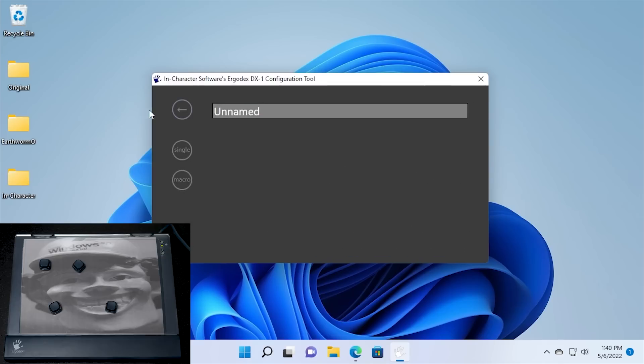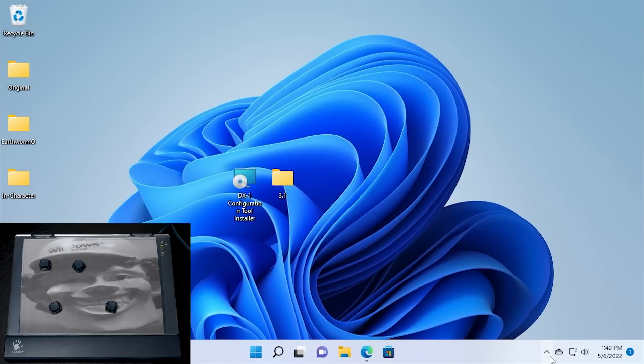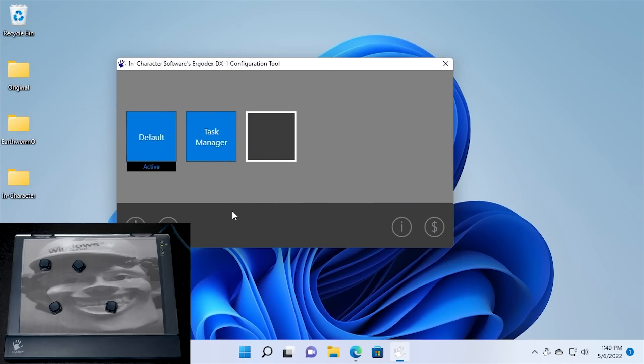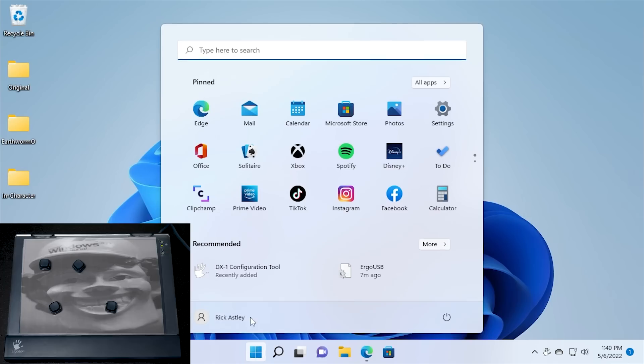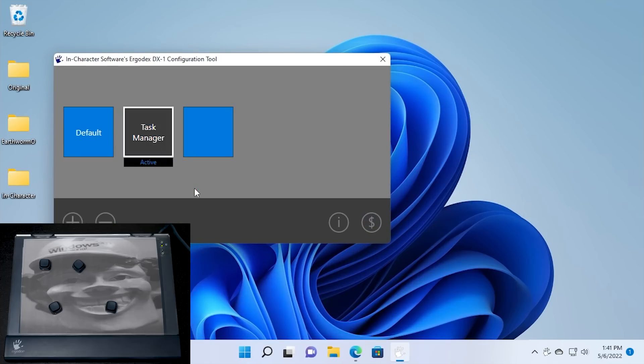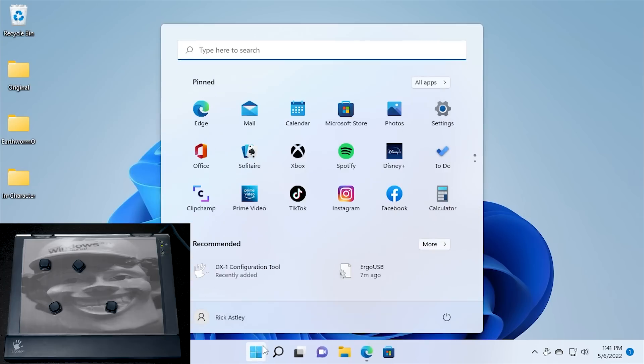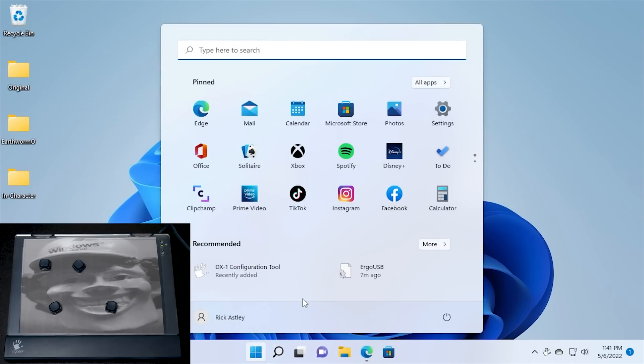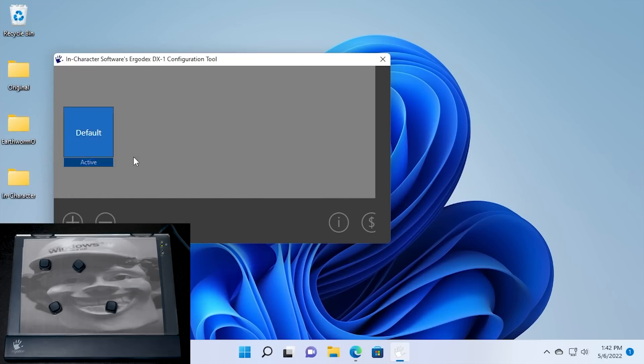Let's try adding a single key mapping. Clicking on the name field caused the entire program to crash — just clicking on it makes the program freak out and quit. After removing all the other macros except the default one, that one is still causing it to crash. So I've set Control Shift Escape to the default macro entry, and that's going a lot faster — almost instantaneous. But comparing it to pressing Control Shift Escape directly on the keyboard, which responds immediately, the Ergodex key still has a little bit of latency. It's definitely not a perfect solution.